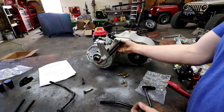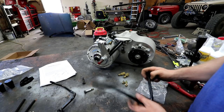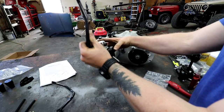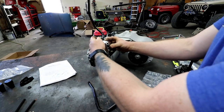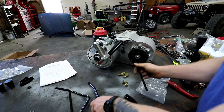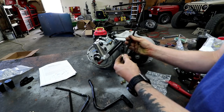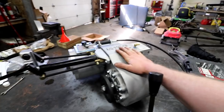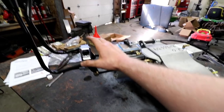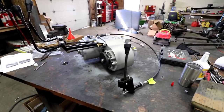I got the first portion installed. This is basically set up so that they give you more than you need, and then you cut it down to whatever your needs are. Put these bolts through here, install the shifters on — this one on this side, that one on that side. Then you use these other chunks of all-thread going between the bottom of the shifter and this guy right here. We're going to bolt this into the Jeep without any of this linkage in the way, and then try to loosely fit all this to make sure it's going to come up through the floor correctly.